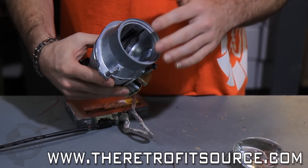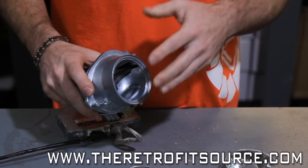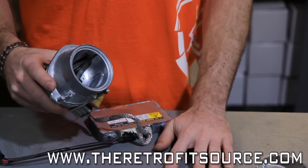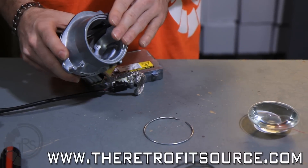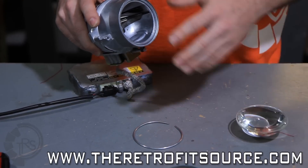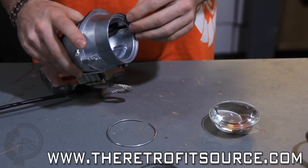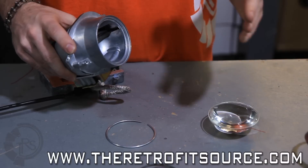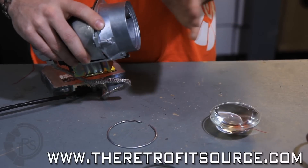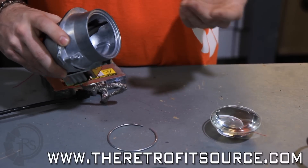In this case, we don't have to do any spacing on the cutoff shield, the reflector bulb, or the bulb itself. We're going to do all of our spacing on the front with the lens cradle. We're going to use the spacer that comes standard with the ST-IR clear lenses to give it a little bit of a push forward. We'll demonstrate on a wall how the light output looks with no spacer, with the spacer installed, and with too much spacing so you can see how the output changes. We're really only adjusting the lens forward or backward by maybe one to two millimeters at most, but you'll see it makes a huge difference on the wall.